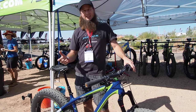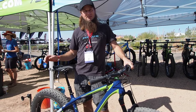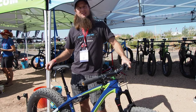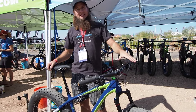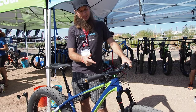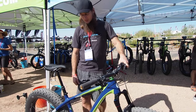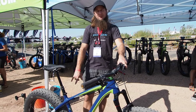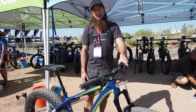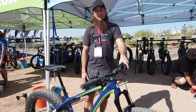In designing this bike, we took the characteristics of our favorite mountain bikes and made them compatible with a 5-inch tire. So I've got a slack 68.5 degree head tube angle when paired with a 120mm Bluto. We have really short chain stays compared to most other fat bikes — we're down to 440 millimeters — which keeps the bike really lively and agile.